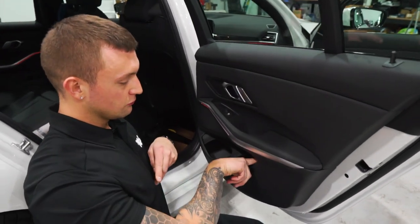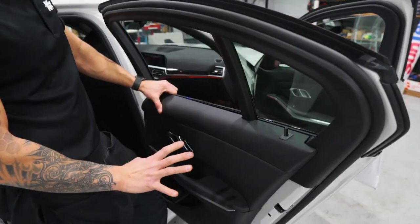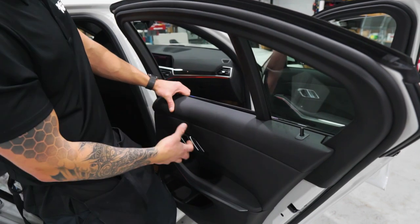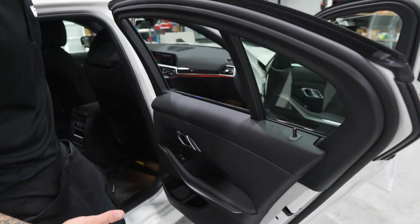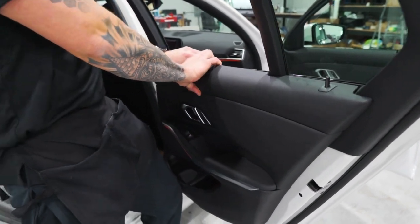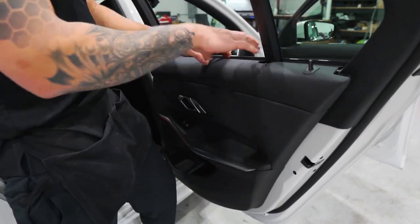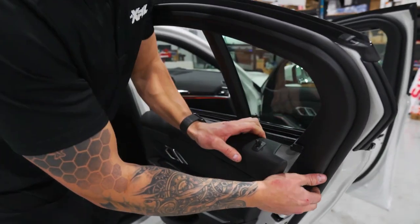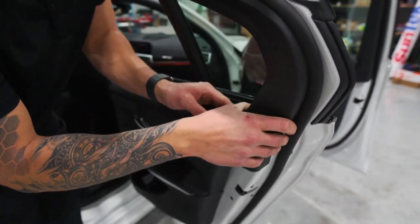Same screw position — one down here, one behind the lever — and repeat for all four doors. Although the panel hooks on top of the weather stripping, it's easiest to start from the top and work your way down the sides, then grab the bottom corner and pop the panel up. It rolls off the gasket easy, but doesn't roll back on easy. That way we can leave the remainder of the panel in place and just remove the gasket, pulling the whole panel off when we reinstall.